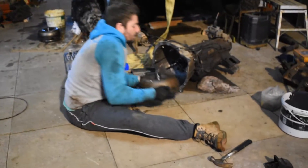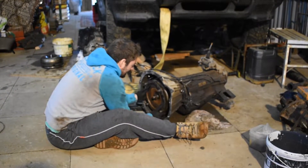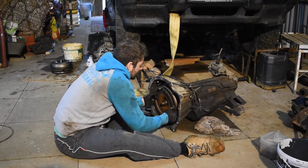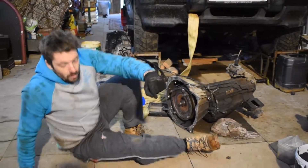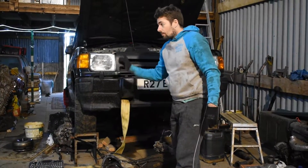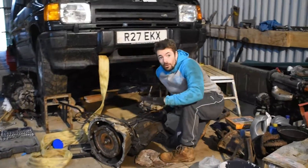The hardest job is locating the lugs of the oil pump. Really important thing: make sure you locate those lugs first with the torque converter, then put it back on the engine. If you bolt it to the flywheel without locating it, as soon as you start it up it will spin around, strip the lugs off, and you won't get any oil flow — it will fall off.